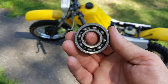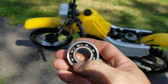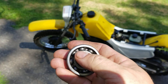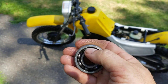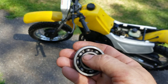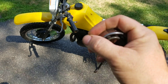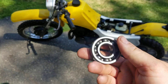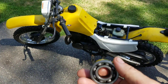So what does a crank bearing look like? I got a bearing right here — they are ball bearing rollers. What happens is, see the center circle right here? This has a lot of up-and-down and side-to-side play. The bearings have actually chewed into what they call the race — each one of these is a race — and it chewed into it. When it chews into it, the crank actually kind of floats orbitally.